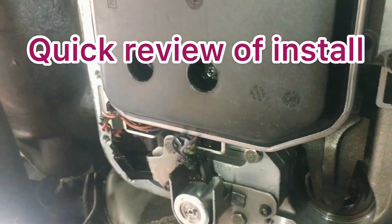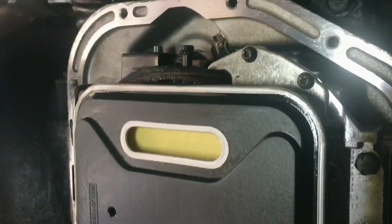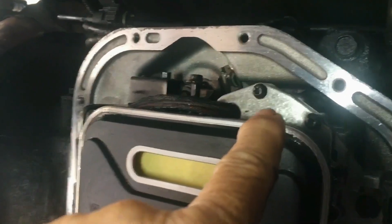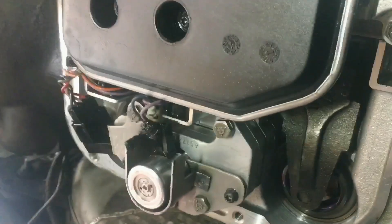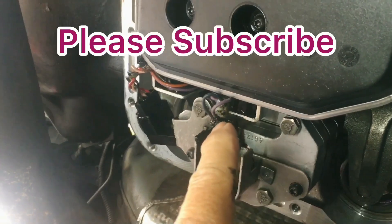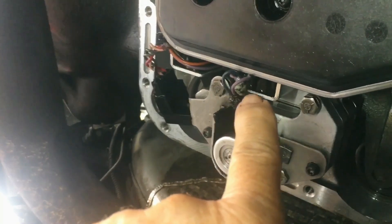Another My Jeep update, a few minutes down the road here. I believe I got everything in place. As you saw, I put the accumulator spring and piston in, and that's the plate — it was partially behind the filter. Filters in. And I put another dab of black RTV on that connector there, hoping that it will help keep that connector together over periods of vibration.